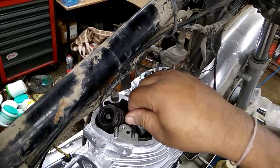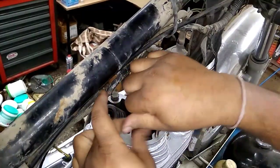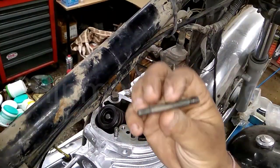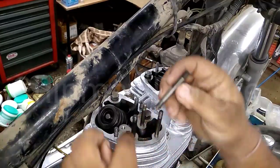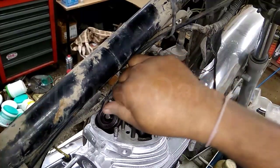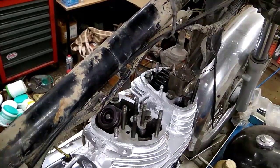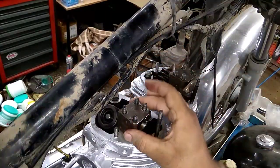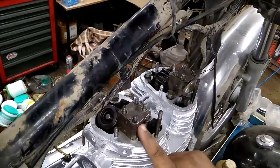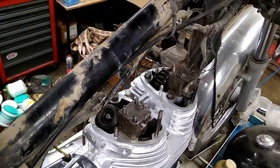The stopper point length is very important. The diameter is different from the regular stud and it has to be fitted diagonally. Most important: you can fix up the rocker boxes without starting the bike. I have seen that people start the bike and then do the rocker tightening — don't do that. The longer thread goes inside the head; the smaller thread is for the rocker tightening. It should go in by hand tight and should not snap out. If you put the rocker box on, it won't move at all. If you start the bike, the whole load will come on the stud threads — so don't start the bike and tighten the rocker box.